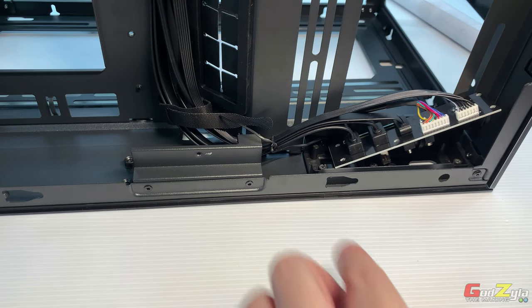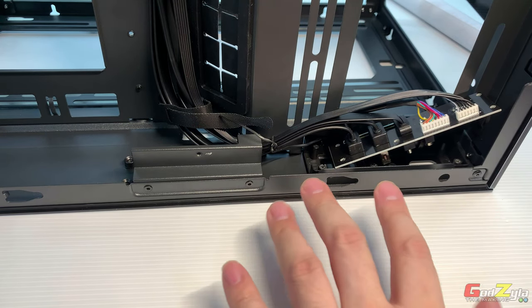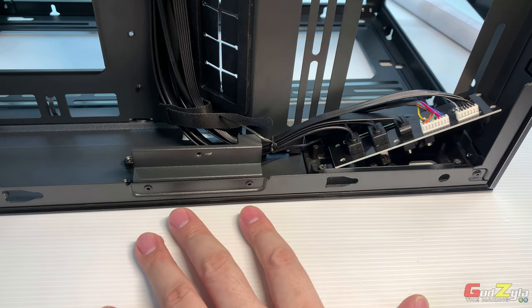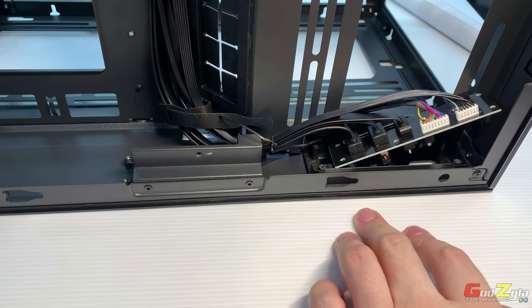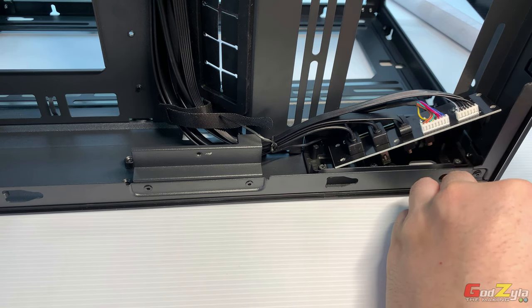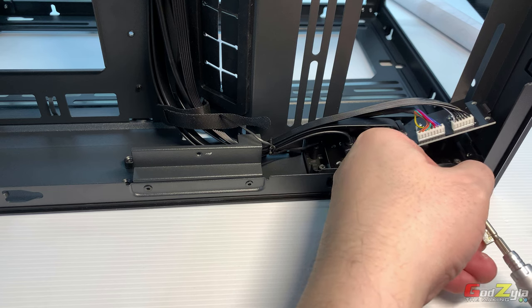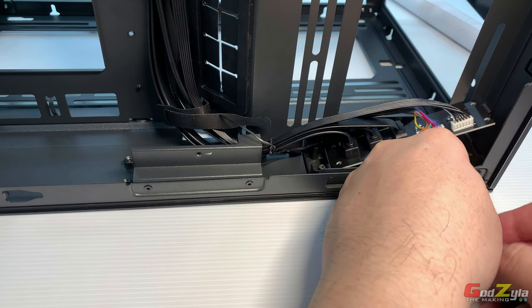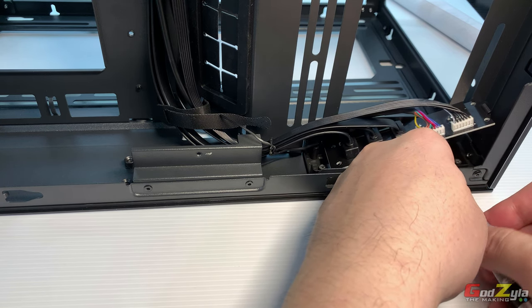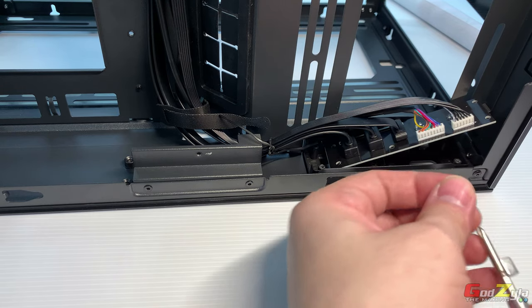Now, when you want to actually screw back the side screws, right, it's best that you flip the case again so that the top is actually facing the bottom. Make sure you have a cushion for it. Meaning you say either a mat or something spongy. Now, I'm just going to screw the sides here. Taking all the screws here. And when you're aligning the screws, make sure that they are aligned straight and not crooked. Reason being, right, if you were to actually do it slanting, right, the thread hole might just wear off. Now, don't have to actually screw it very tight, just hand tight will do.